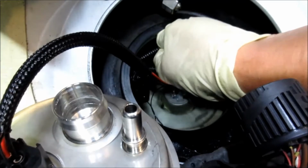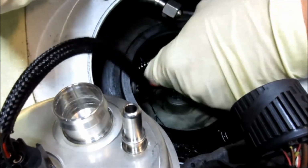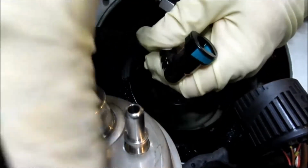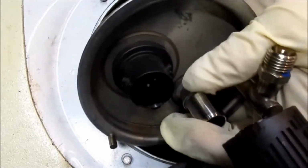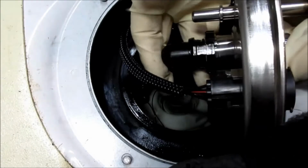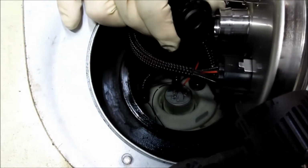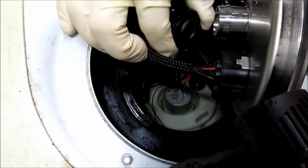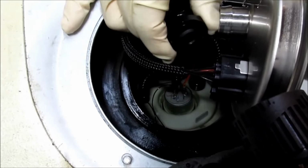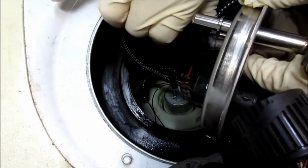and we're gonna have to pull out the pressure line right here. We will start with putting that one back on first and just slide that up in. And to release it, you press on the tabs on the side right here. And I'm pressing with my fingers. You press on those tabs. That releases it and lets it come off.